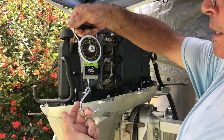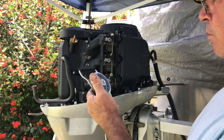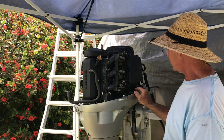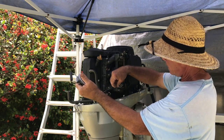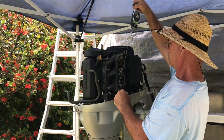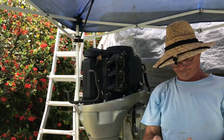It's for checking your luggage. Goes up to 75 pounds. Has a little tell-tale needle. And that was 10 bucks. So we're about to use science now to make some calculations here. I removed most of the other linkage forward of these carburetors. I should be able to hook the servo right down at the base of the primary carb. Let's see how many pounds it takes to open them. About six pounds — not much. Should handle it.